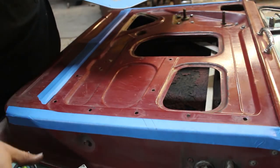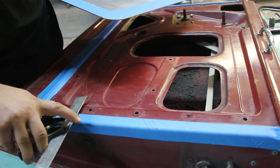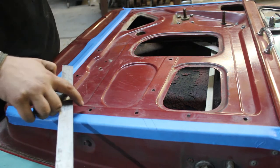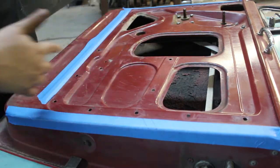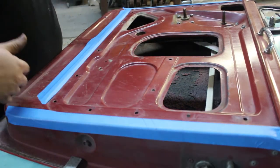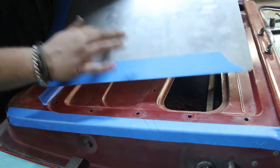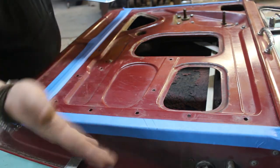We'll do the same with the speed square: put it here, measure from the bottom, make a line, then measure up with the calipers half that distance, and measure over. That puts an X right where we need to drill for each of these holes. I'll let you see that process — it is time consuming, so I'll time-lapse it. The door panel comes on and off repeatedly, that's why it's good to have those reference lines. Basically that's what I'm doing.